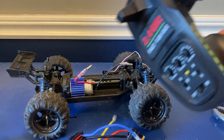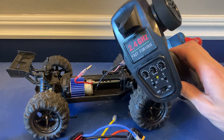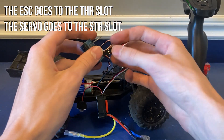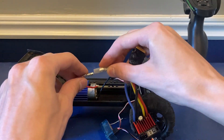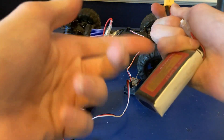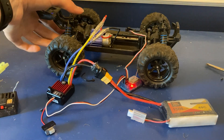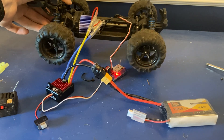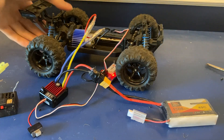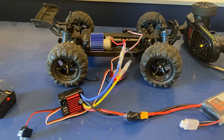So to make sure everything works correctly I'm gonna hook up this new receiver to the ESC and hook up the servo to that so we can test it. This is a PX Toys receiver and the great thing about it is that it actually works with the radio that comes with the car — there are two different radios you can get with this car and it only works with one of them. You plug the servo into this one and the ESC into this one. I don't know which of these wires is which so I'm just gonna hope this works — yellow to red, blue to black. For the first plug-in I'm just gonna try it out with this 2S LiPo. All right yeah so we've got steering and throttle — it's just backwards so I'm gonna swap those around. All right that works.